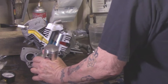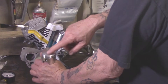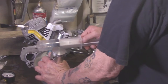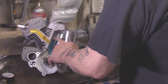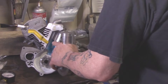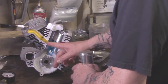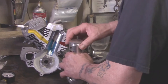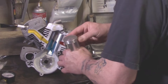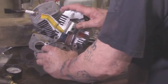One important nugget of information: if you've got a big hole in your piston you're not going to be creating suction. Or if you've got a big chunk taken out inside your cylinder, you can have air sucking in where you don't want it. That's an absolute fundamental. If you're missing your piston ring or pieces of it, you need all of both rings on in order to create that suction.